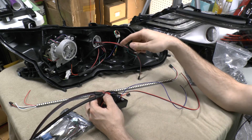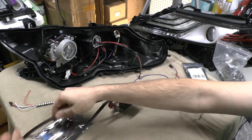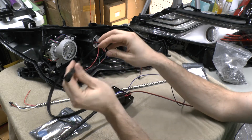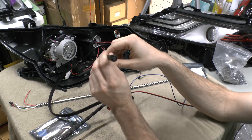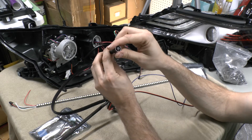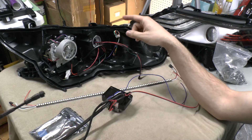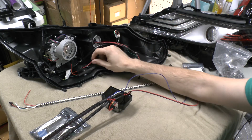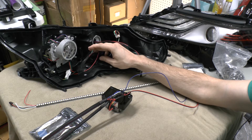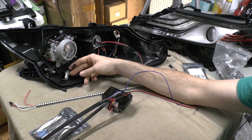I run that to the headlight, and that way I have a 12-volt coming in — which is coming from here — and then it connects. These are the connector styles that I'm using now. I find new stuff here and there and switch out; you can get these pretty cheap on Alibaba. They are a little easier to work with, a little more sturdy, so if you're a little rough with the connections, it's not as big of an issue. It runs down the line, through this, into the back of the headlight where I have another plug for the quick connect. Through that I have the 12-volt power and ground, the 5-volt power and ground, and the data line right here, going into my Demon Eye. I've actually got the driver underneath, and then the output.